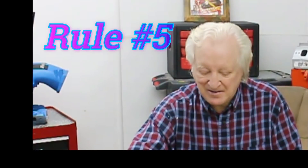Now let's look at rule number five — this one is so misunderstood, it's unreal. Shape is all important. A shiny finish is not. There are certain posters on YouTube who've managed to get a huge number of hits on ports where they have simply polished them, and there is this very common belief that a polish is what makes the head work. It's not. In fact, a polished finish usually drops power. We'll talk about that when we get to that section. I've now covered the five golden rules.